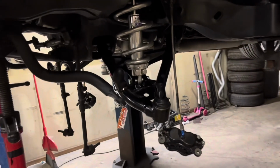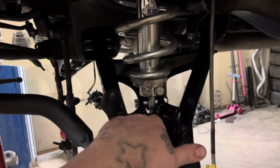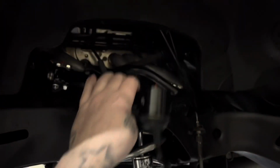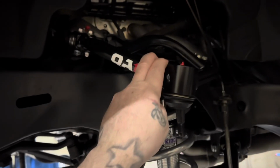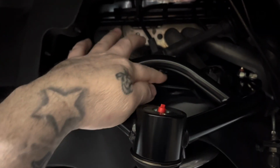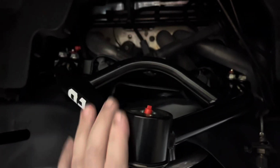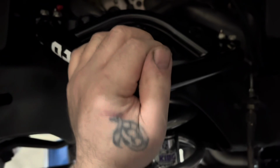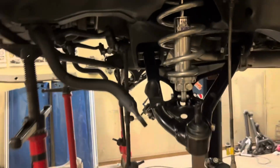But yeah, that's the new style. The old style had bolt-in plates in the bottom. If you watch my videos, you know this is the new style. The other ones had a 4-bolt, a stock ball joint would bolt into this area. I take out the stops because with bigger wheels, that rubber stop would hit a lot sooner, which would limit the travel. And when you go down the road, it'd be bouncy. But anyways, the spindles, boom.